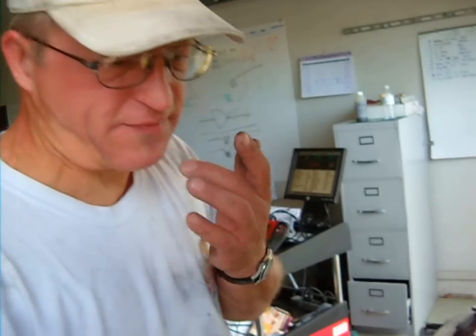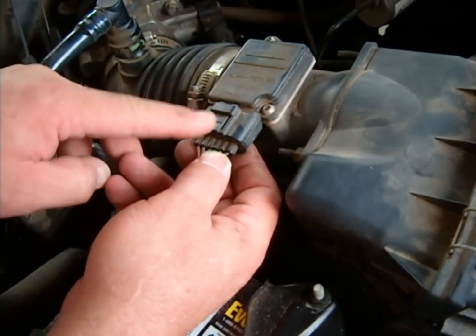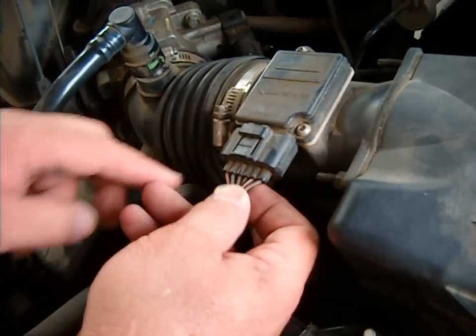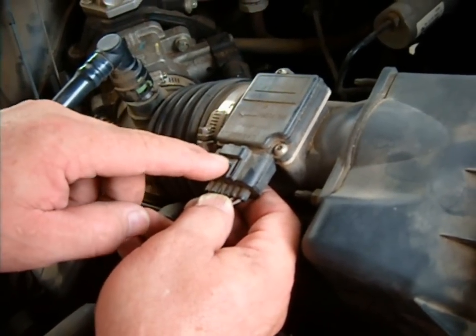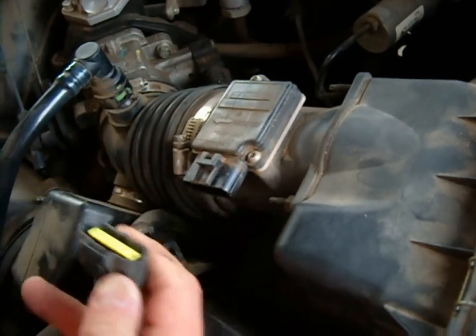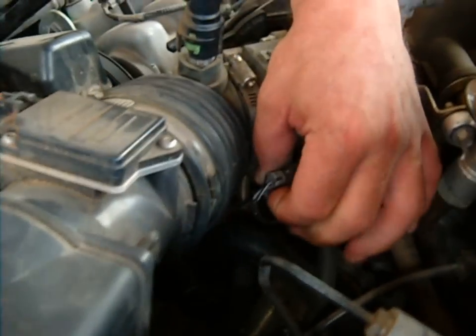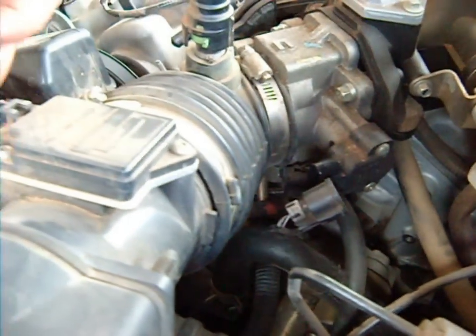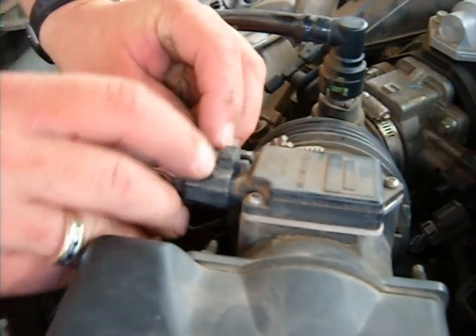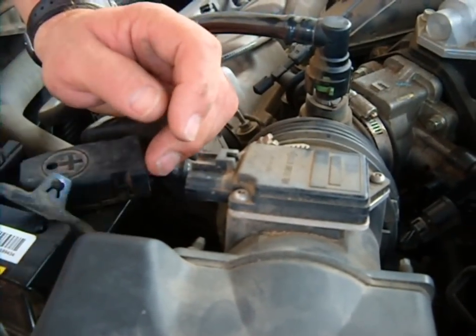There's not much to this — I've just loosened up a couple of screws and I'm going to pop this loose. It's really important that you handle these electrical connectors with care, because you don't want to pull on the wires. If you do, you may render the unit non-functional. On this particular type, push down the clip and wiggle it, and it slides right off. The same thing with the throttle position sensor — there's a little lever you push and you just pull the clip off. Some of them have a little retainer that's a different color; slide that retainer up, push on it, and it'll open up — it's just a security measure.